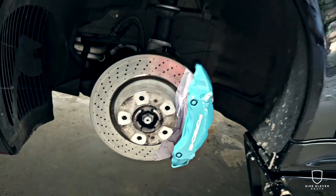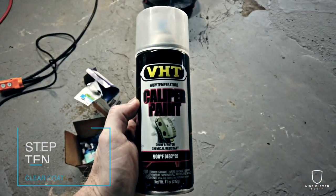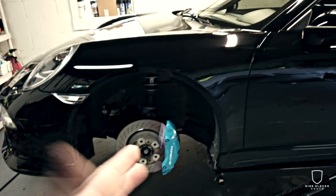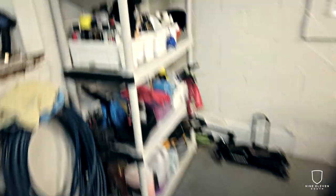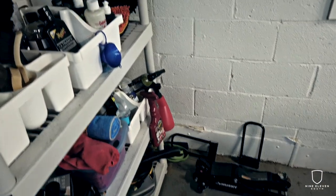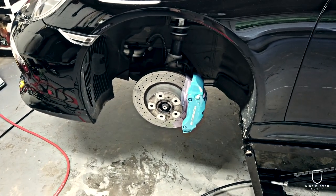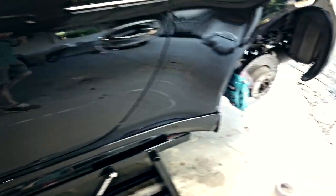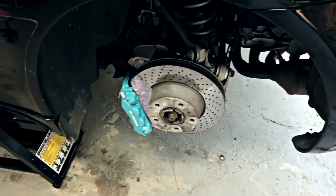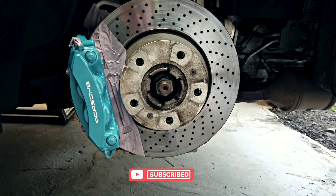I'm going to throw some high-heat clear coat over this — I use VHT caliper paint clear coat over the top of that. Let that dry, put the wheels back on, and we're good to go. One thing I'll also probably do before putting the wheels back on is apply some C5 wheel armor on the calipers, for the same reason you put it on the wheels — just to make sure brake dust doesn't collect on there, so when you pressure wash it should flow off nice and easy. Once both of those are done, the project will be complete. I hope you enjoyed the overview — hopefully it's helpful if you're thinking about doing a DIY on your calipers. If you've got any questions, leave them in the comments below. Please like this video, hit subscribe if you're enjoying the build, and we'll catch you on the next one. Thanks.